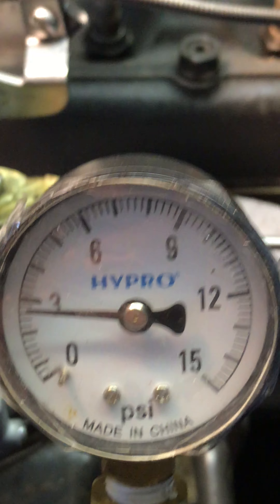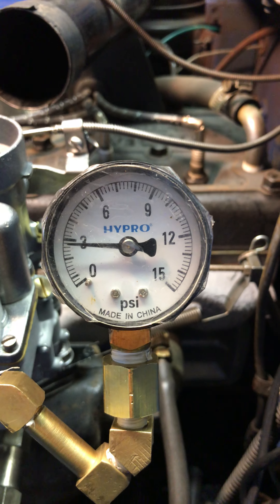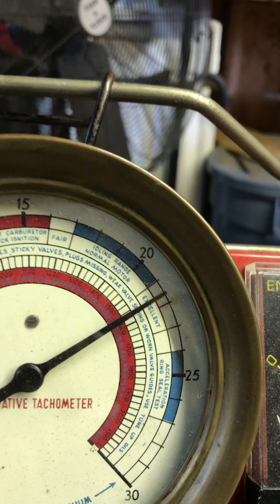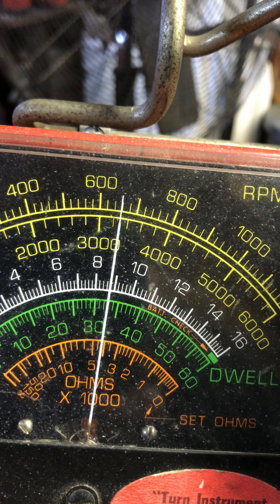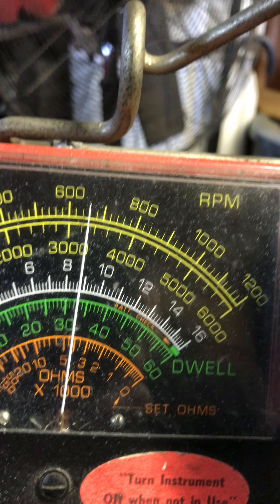Get wide open. Come back out, and you can see that fuel pressure is about 2.8. Take a look at some numbers here. Vacuum, 21 and a half. Auto RPM is about 660. I'd leave it right there. That's good.